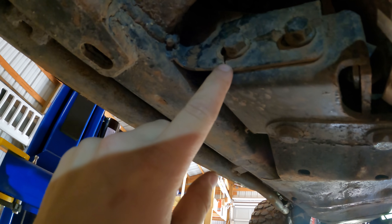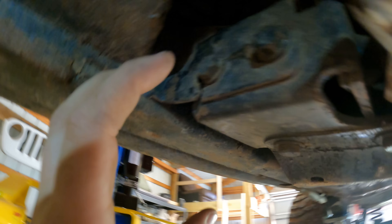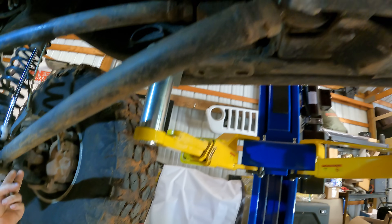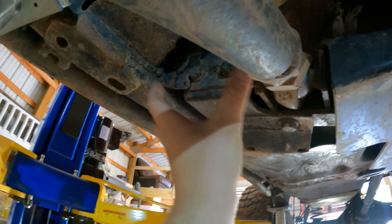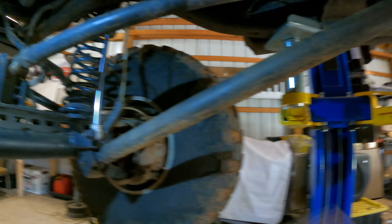What that did at one point was crack this bolt hole. It's really dirty under here, but I can tell this has been there for a while because the crack is still a little rusty — so it didn't happen on this last trip out to Moab. However, what I think happened in Moab is the whole crossmember actually shifted back. It cracked, we must have hit something with a tire, put an additional load into the crossmember, and cracked that. At some point this is going to continue to crack, and we could possibly have the whole crossmember fall down, which would mean our transmission, engine, and side pieces would fall down, the lower control arm link would collapse, and our axle would roll back. It would just be a horrible series of events.